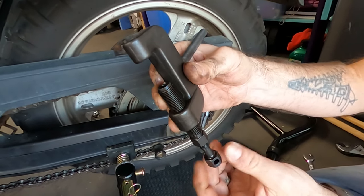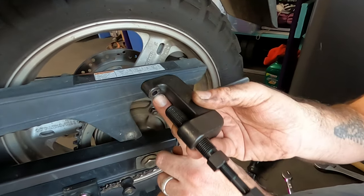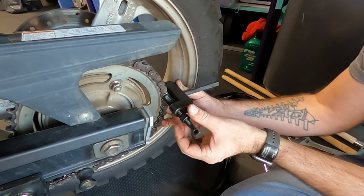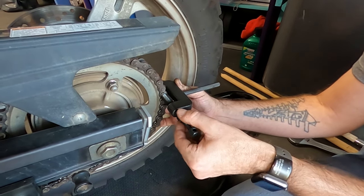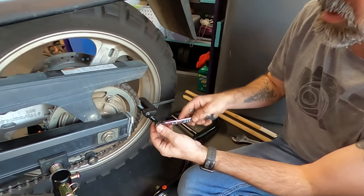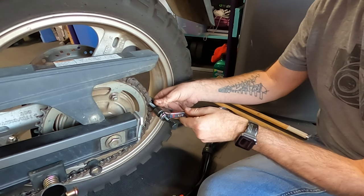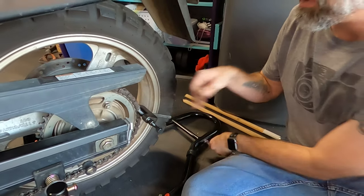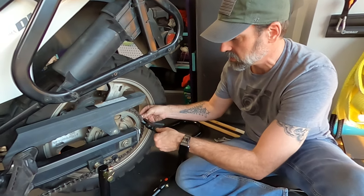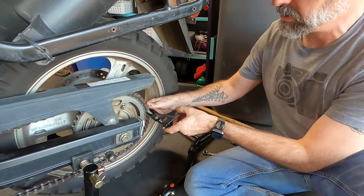So see the little plunger that's coming up here? We're gonna back that off till it's inside again. Then on this side, on the back side, we're gonna put this where the rivet on the back side of the chain of the link that we want to remove. Then we're going to tighten up the outside guide bolt until it's snug. Then we're going to take a 9/16th and tighten that up just a bit to keep it on there. Like that. Then tighten the plunger bolt and the plunger. Make sure it's all seated nice and secure and centered. Handle. And we go at it.